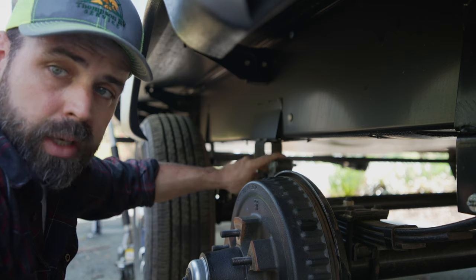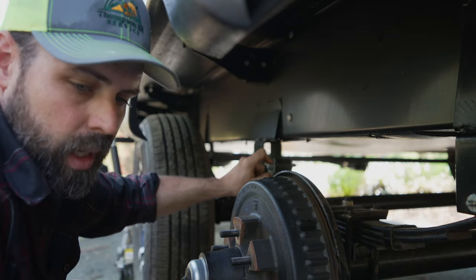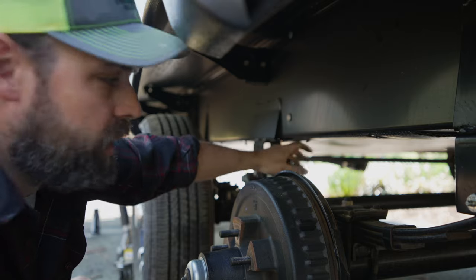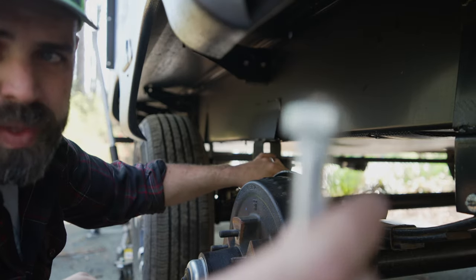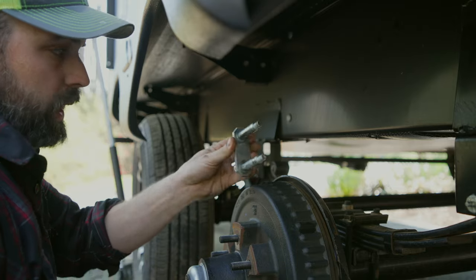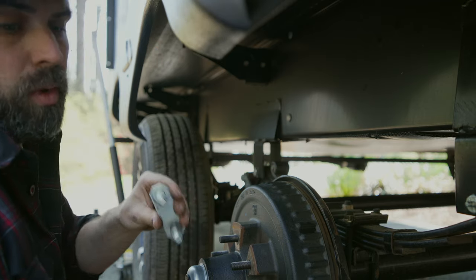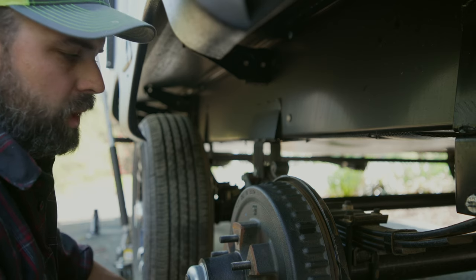One thing to note: if you're not doing the wet bolt upgrade kit, when you take the bolts out you'll need to hit them with a hammer because those grooves lock in. Leave the nut on, get everything loose, back the nut off a little bit, then use a regular hammer to tap it — do not hit the actual threads because you'll regret it when you go to put them back in. Just leave the nut in place, loosen it a little, and use it to drive the bolt out that tiny bit. I do have some jack stands just behind the tire just in case a jack gives out — safety first.